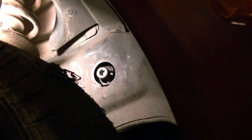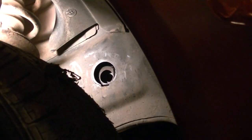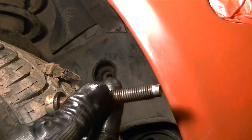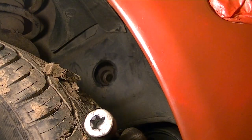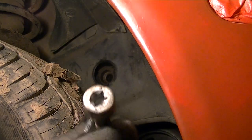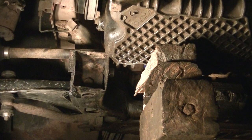On some forums I've seen these bolts actually broken off in the side of the engine block, and a lot of people have trouble getting them out. You can see just how big and long this bolt is. Make sure you get a good star bit in there and the correct size — this is your only chance of getting the bolt out cleanly.